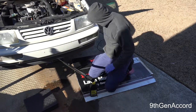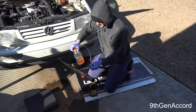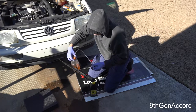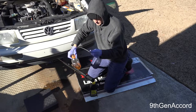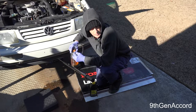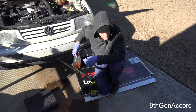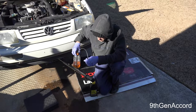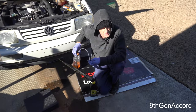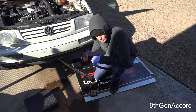I just have an old Gatorade bottle with some holes drilled in it, a piece of rubber tubing — some vacuum line — and some old brake fluid in the bottom. This lets me see any bubbles. There may be some bubbles when we first start from the air in the line. The method I'm using is called the one-man method, also known as the drip method or gravity method. I've never had a problem doing brakes this way on all my vehicles once a year. You can also do the two-person pump-hold-and-release method — that's fine too.